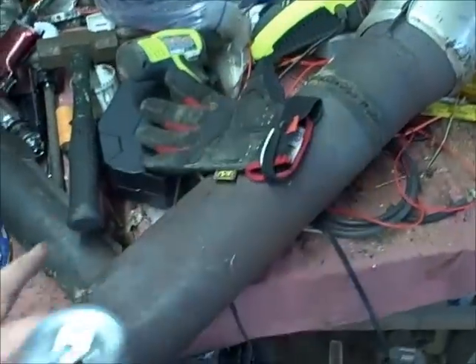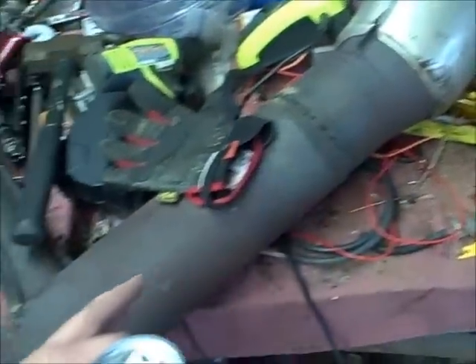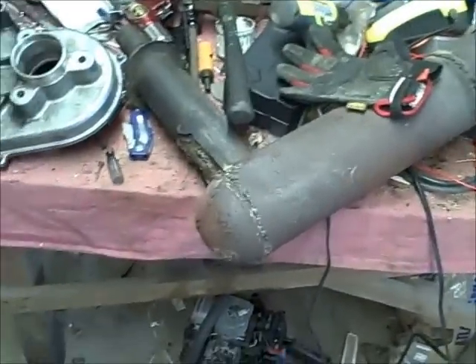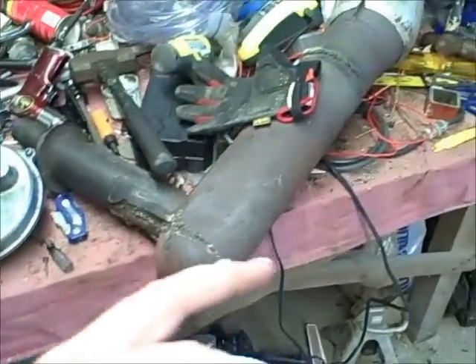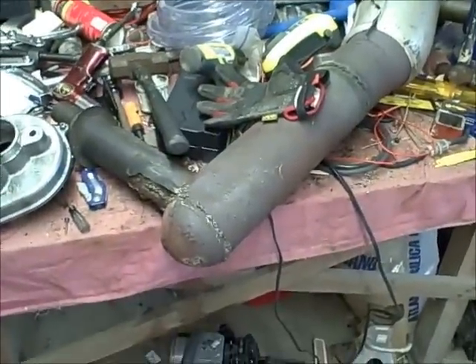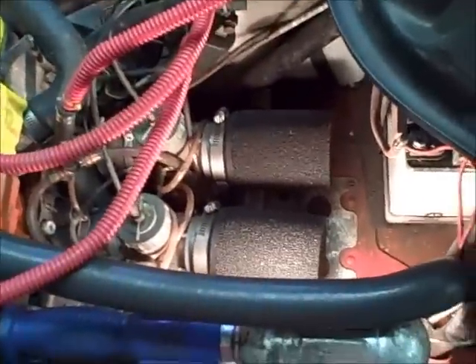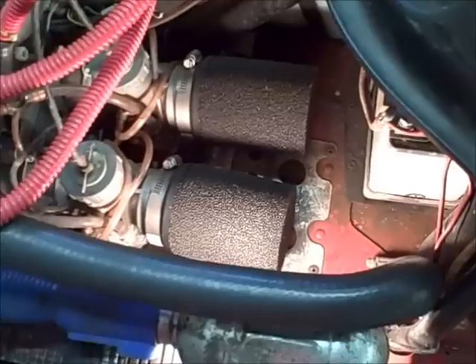Over the years I've done some modifications. On this stock exhaust pipe I actually cut it here and here, slid the whole thing apart, cut out all the middle baffles, put it all back together and re-welded it. It's not that pretty but it works - kind of hollowed out the baffle section, made it a little bit louder but not too loud, and gave it some more power. The other modification I've done is eliminate the air box - the air box is kind of restrictive - and I put on two separate Uni air filters, which gives it a little bit more power. I've noticed that it takes longer to warm up the engine now.